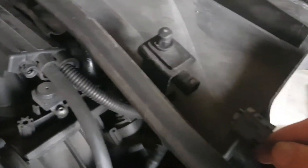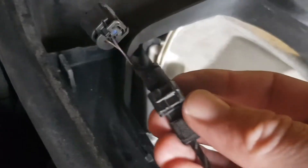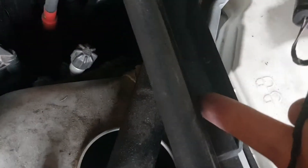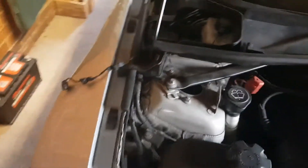Exactly the same on the other side — little rubber grommet things here and here, a couple of clips there on the other side, and that lifts off. Then once you have those off, that gives you access to these little electronic clips. You just pull them back — I just pull them with a wee pair of pliers off the little bits of plastic they were on, and you just hang that down like so. Exactly the same on the other side.